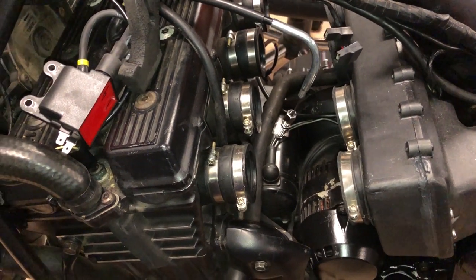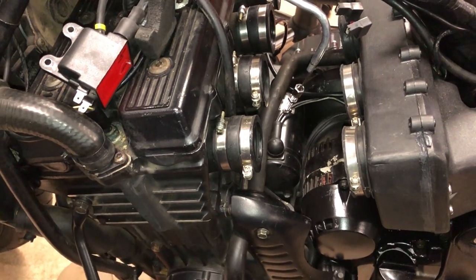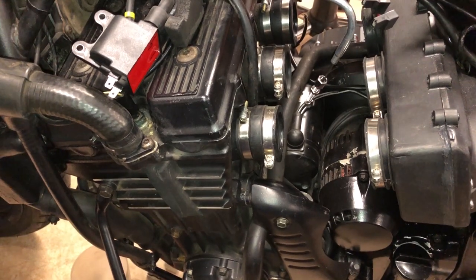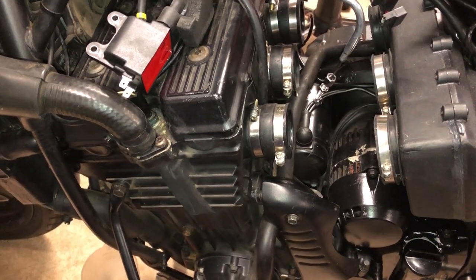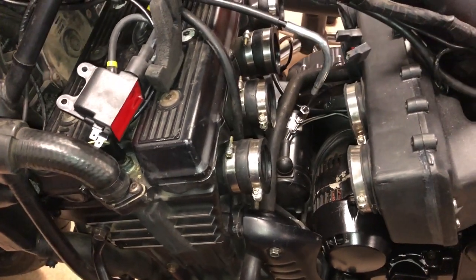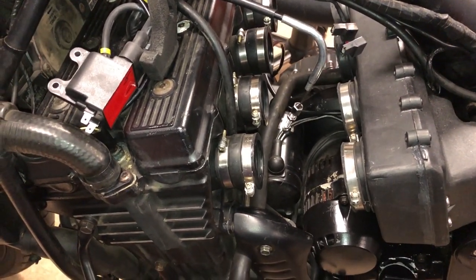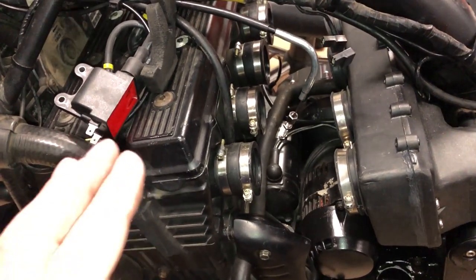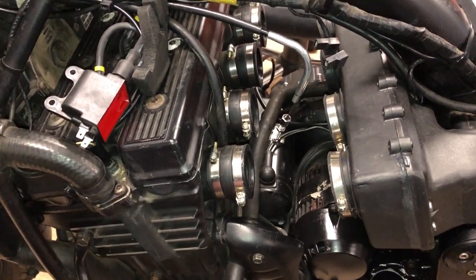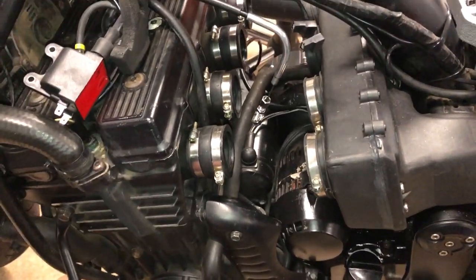I've had some awful starting problems with this bike. On choke, when the engine's cold, it's turning over fast enough, but it wasn't starting well and the exhaust was cold. It was like you can feel it starting on two cylinders. I've had the carbs off so many times because I'm convinced it's the carbs. Meanwhile, I've changed everything — plugs, HT leads, coils. Everything's been changed.